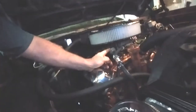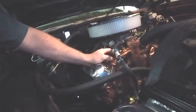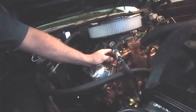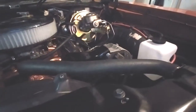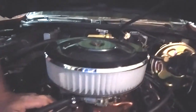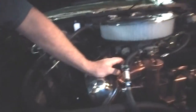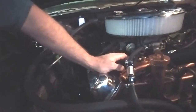I did also remove the carburetor to give me full access to the top of the motor. That was a big help. And then I removed the alternator bracket and painted that. The water pump I painted off the car. These pulleys I painted off the car. I think the power steering pulley I painted while it was on the car — I just moved trash bags around it and cleaned it up using some degreaser and some lacquer thinner.